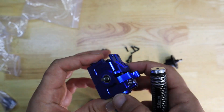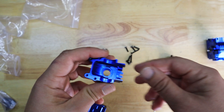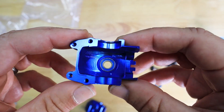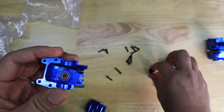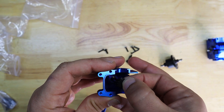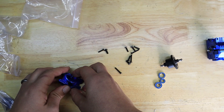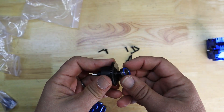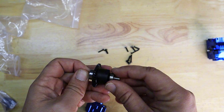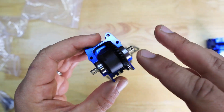We're going to go ahead and apply the grease in a little bit, but let's do the front one first. For the front, take the front part of the differential housing, put the bearing inside first — spin it, it spins nice and freely. Then take the output pinion for the front and slide it into the bearing, right there. Then take the differential, put the bearings on each end — they only go one way so you really can't mess it up. Put the other bearing on the other end and slide it in. Wow, this thing spins like butter.